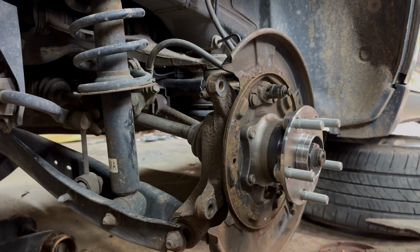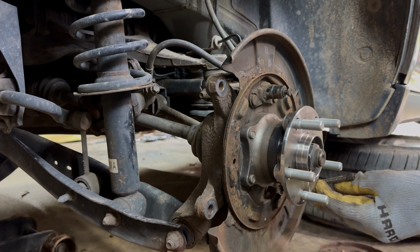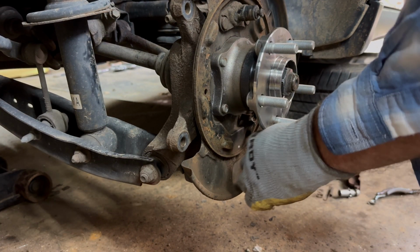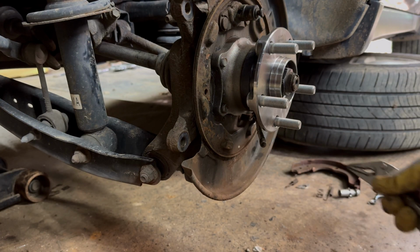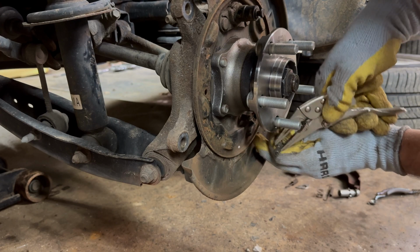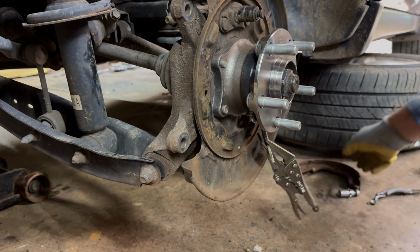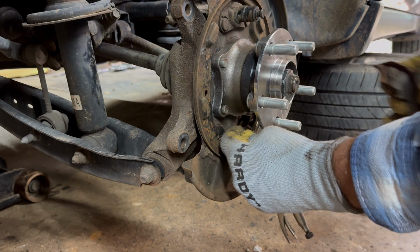And then another thing I do is I take these vice grips and I'll take this little piece right here. I'm aiming down that camera just a little bit. I'll take this and, well, can't really show y'all. I'll slide that spring up. I'll get these in there. And then I'll slide it up even further and latch it down. That way I can get my parking brake back on.